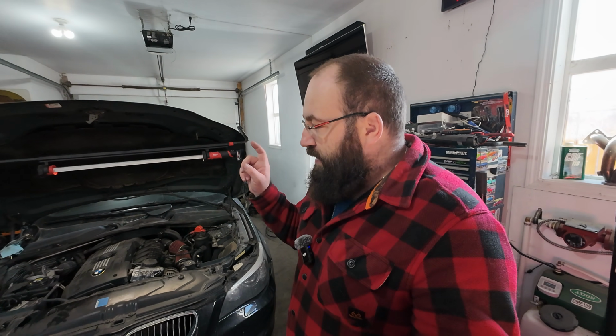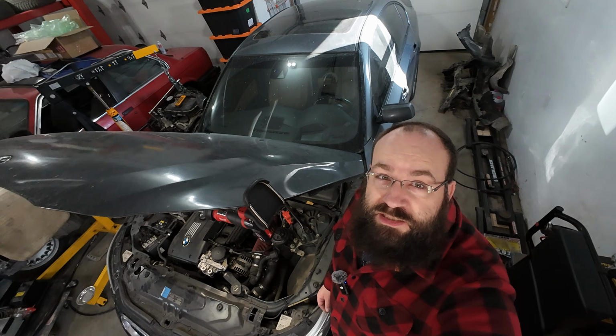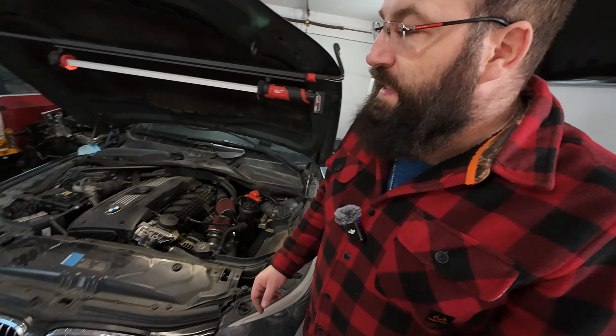In this episode, we have another broken N54. And not just an oily, leaky N54. This one is having a coolant problem. It's a little bit of a unique one. We've got a 535xi. Now, the car overheats for some reason if you go on a longer drive, if you go uphill.